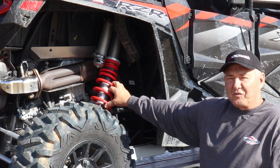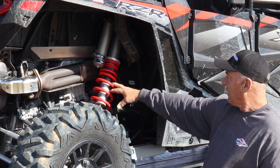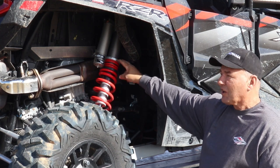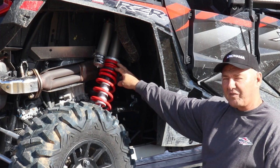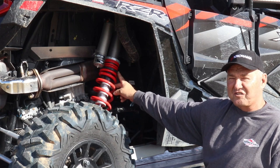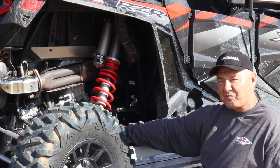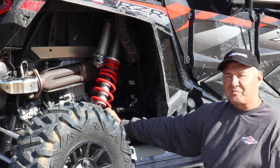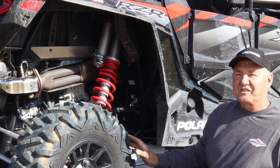It's comfortable but there's room for improvement. What we have here is a preload ring, a small four or five inch spring, then a slider which separates the springs, and then a main spring. Now I'll go to an alternate suspension system and explain the difference.